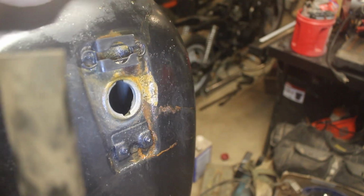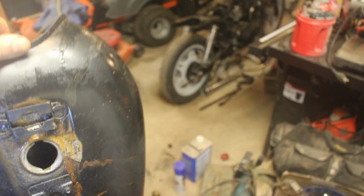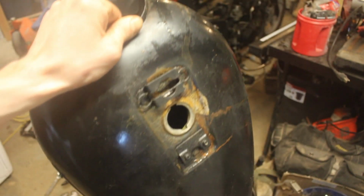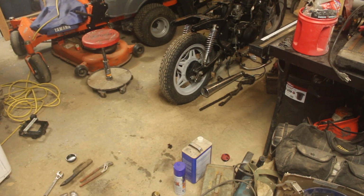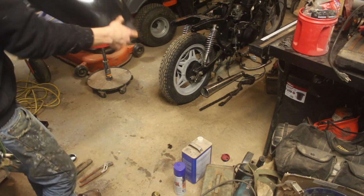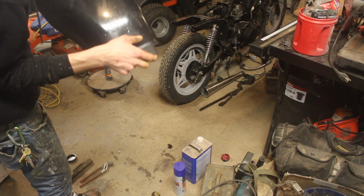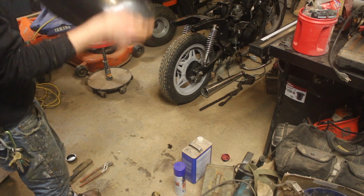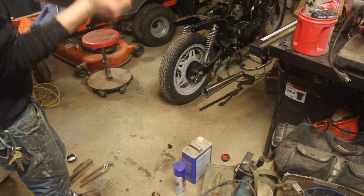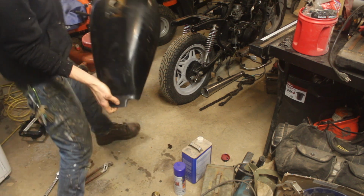The apple cider vinegar actually did what it was supposed to do, maybe a little too much. So I am going to fill it with gas so it doesn't flash rust, which means that condensation, kind of moisture, can rust all that. It looks like it's actually galvanized or potentially just spotted from the apple cider vinegar. I got a little bit in there still in the reservoir, and I tried blowing it out with air.